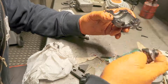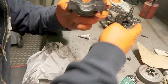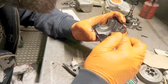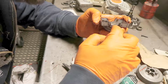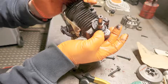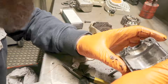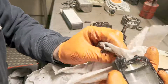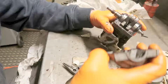If you discover your saw is scored and you can't find an obvious reason, the vacuum hose is good, the intake manifold is good, and everything seems good, many times the reason is the sealers on the crankshaft. These rubber parts here, you have one on each side, and in many cases that's the reason they get worn out. These I've changed not so long before I got my camera, but next time I'll film while I'm doing it. It happens not a lot, but it sure happens.